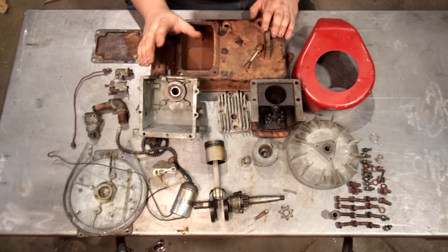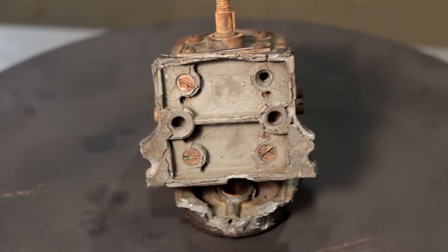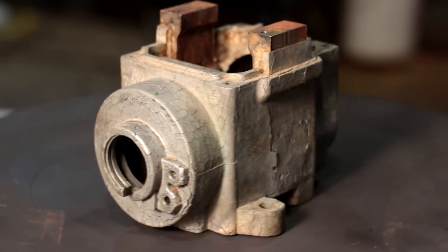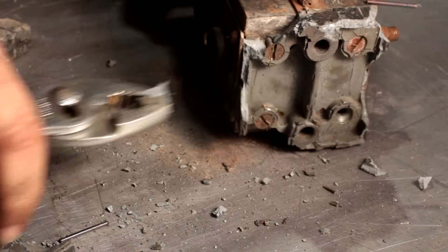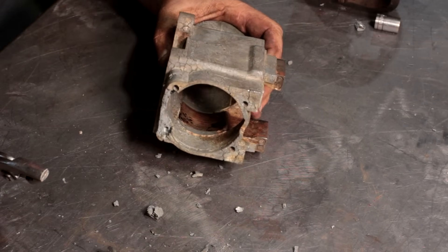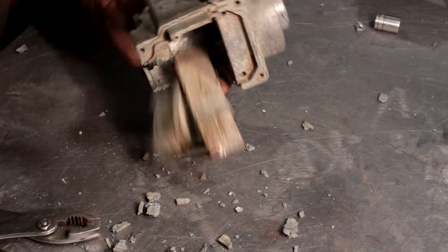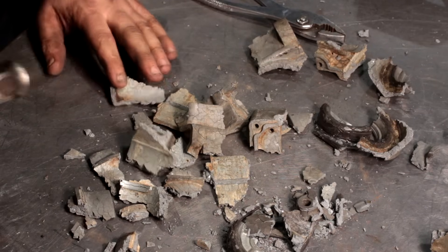With this engine, it hasn't done it. But I do have some examples to show you guys what this engine could have done. I have a couple of mags here with some mild pot metal problems — this is something like a model 12 off some sort of Fairbanks — and then I also have this RV one mag housing, which is also a Fairbanks engine mag. When pot metal does this, it becomes very brittle, and just with a little bit of elbow grease you can take it and break it. You don't want material this brittle making your engine block, because you can just grab it, break it apart, and it's junk. This was a common problem with zinc alloys, and now I have a giant mess of metal crumbs.